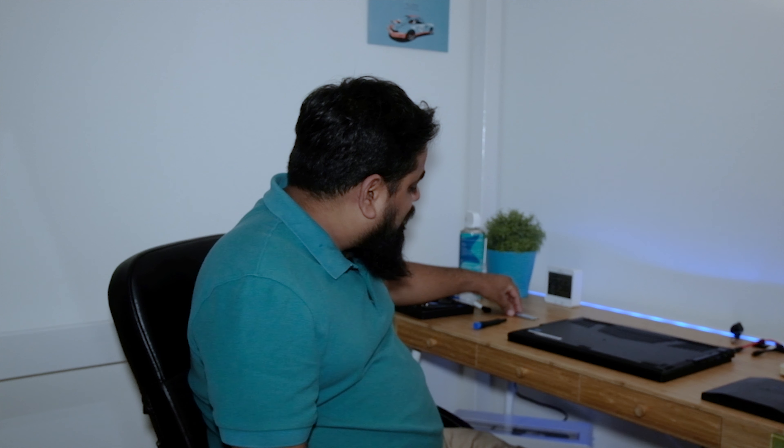I'll be adding this Western Digital 1TB M.2. M.2 SSDs come in two categories: NVMe and SATA. NVMe being the faster ones. If you're purchasing an NVMe SSD, just make sure you have enough PCIe lanes and that your laptop supports NVMe. The NVMe ones are really expensive — the Western Digital I got is $250 for 1TB, while NVMe options like Samsung are around $450 for the same storage, almost twice the price.